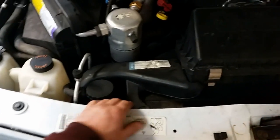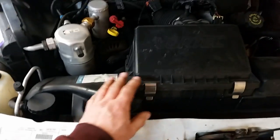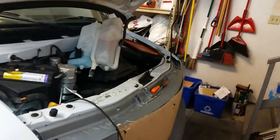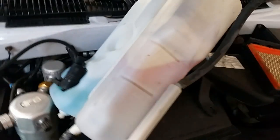You probably want to disconnect this hose on your radiator cap. I went a little farther — I pulled this off, it pops right out, it's got a couple tabs. I pulled that all out, got that out of my way. I also took out the overflow tank and the air cleaner, got all that crap out of here.